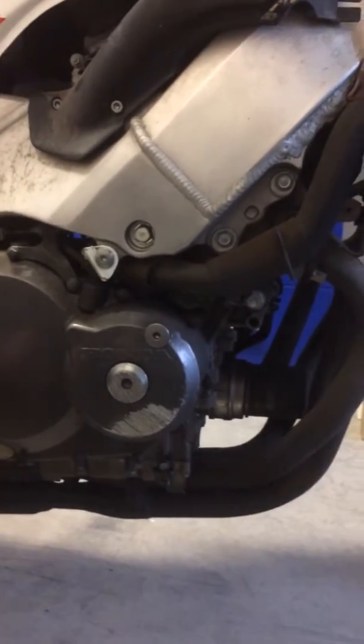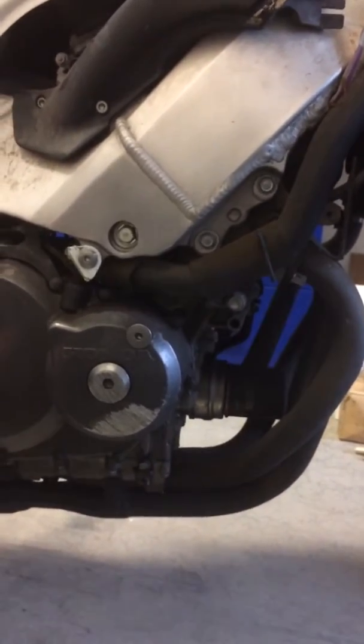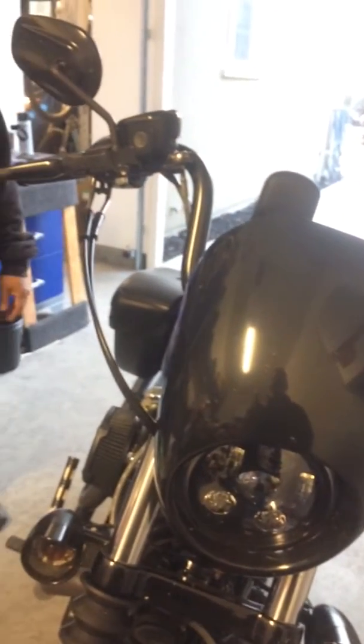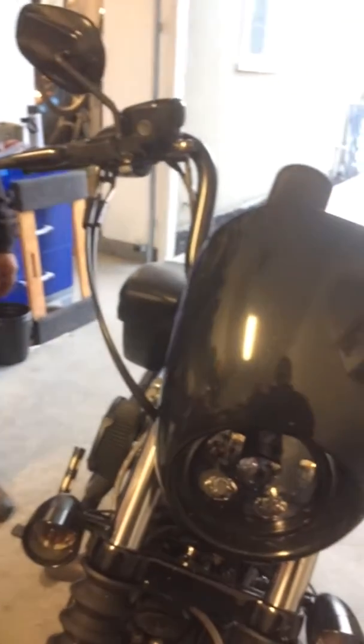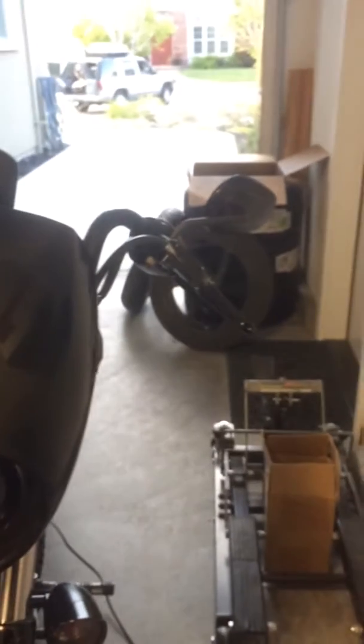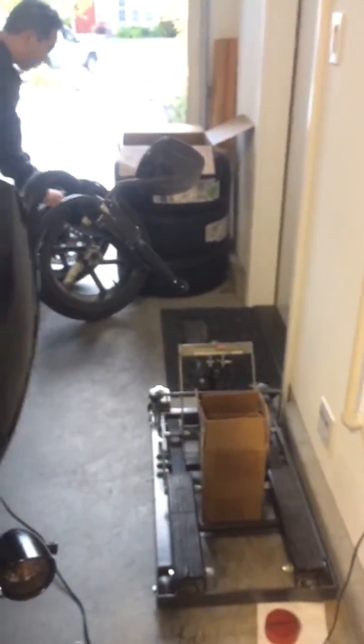I was telling him, I just think it's a bad idea to put a different wheel on it. It's like a 17-inch wheel, and he bought a 16-inch wheel or something. You might get lucky, and your brake rotors might bolt up to it. Maybe, maybe not. But it's already a different dimension. You can tell that it's already taller and fatter. Yeah, it is a little taller. So you might get some rubbing if you're unlucky.